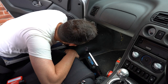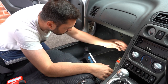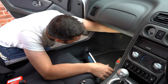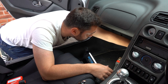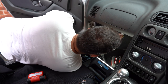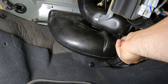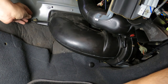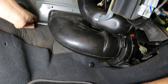From other videos I've seen on this topic, you also have to remove this sort of pipe bit here which feeds air in from the bonnet area into the blower itself. Because I can't see where the resistor pack thing is, I'm going to remove this. There's a Phillips head screw down here and there's a 10mm bolt nut here. I'm going to try and get this off so I can see something.